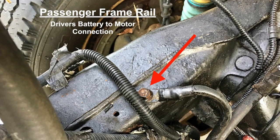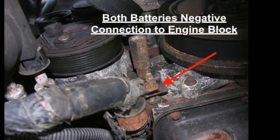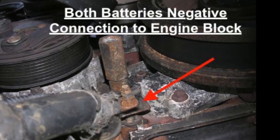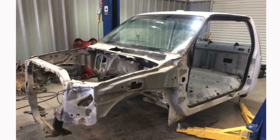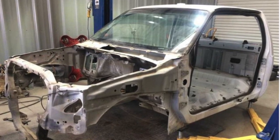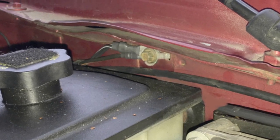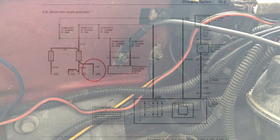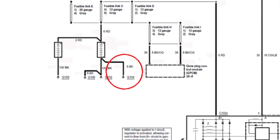With the 6.0, we have one major connection of the negative cables to the block — unlike the 7.3 liter, which has a cable from each battery directly to the block. The second ground plane for all other electrical components is the welded assembly of the body tub, and all component harness negative connections are made to the tub by means of fasteners. These connections are located in the engine bay and cabin at many locations. Each location is a potential for a poor connection, resulting in a voltage drop for its component.